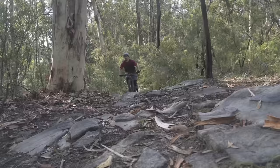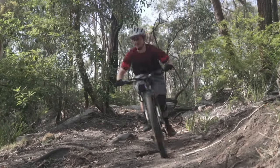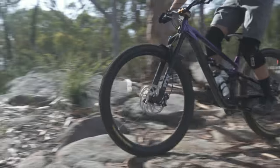The Fox 34 is just going to be that little bit stiffer, a bit more controlled when the trails get rough, and it's going to keep up with repetitive hits a bit better than the Recon. The ability to add volume spacers is also very welcome. But what a lot of customers do is get the T7 to save a little bit of money, then down the road as they progress, they just upgrade the fork with the money they saved.